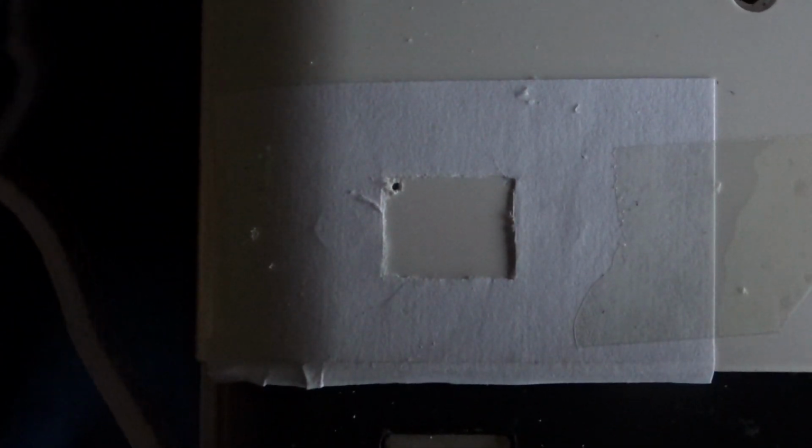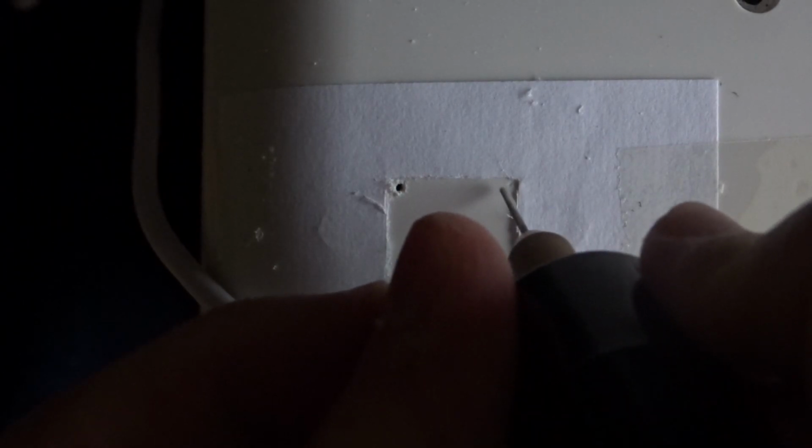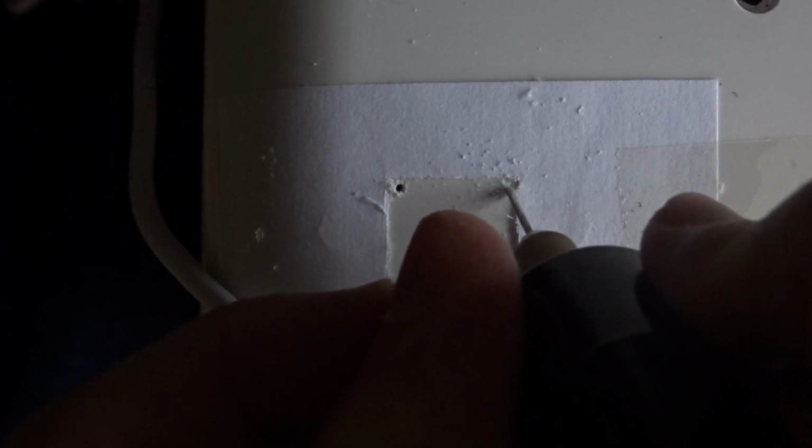Once everything's been fitted, you can now repeat the cutting process on the outer panel. Just remember that unless you've chosen to cut straight through both and have the screws on the outside, you're not going to need to cut screw holes into this panel. You might also want to consider adding a bit of extra clearance on the Ethernet port to allow extra room for particularly large locking clips.